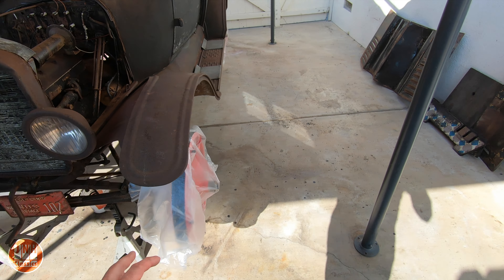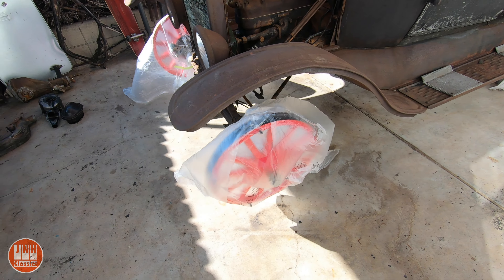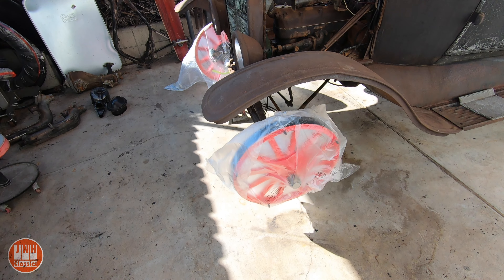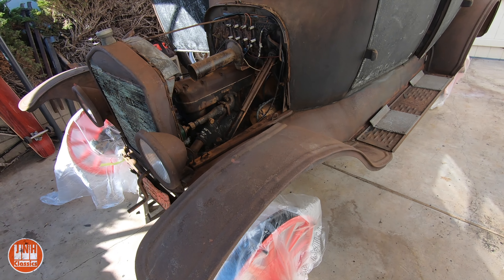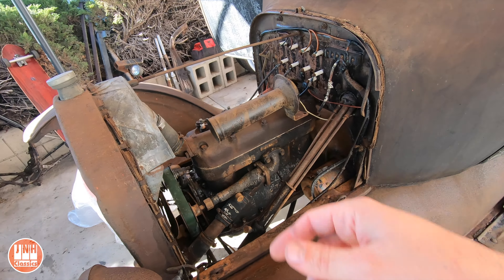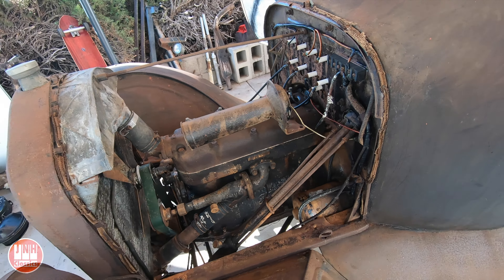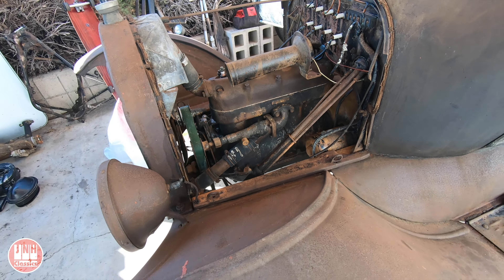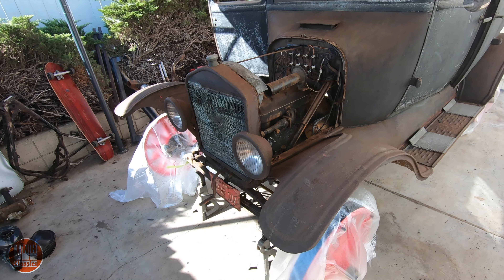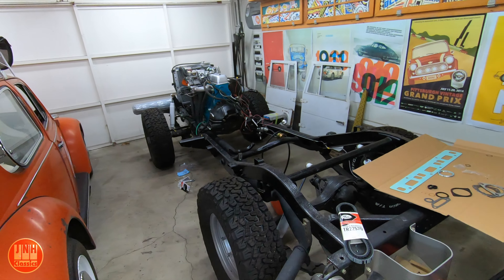Over here on the Model T, I've been trying to get this fuel cap out — this thing is completely seized and stuck in there and it's all broken. It was broken before I even got the car, so somebody tried taking this off a long time ago and couldn't do it. I've just been soaking it with some penetrating oil and hopefully after a few days I'll be able to get it out. I was also able to get a new key for it — the car didn't come with the key, but luckily they're all numbered and there's a number on the key slot. I was able to buy one on eBay for about $10, and of course it was seized and didn't work, but I put some penetrating oil on there and now it's turning fine.